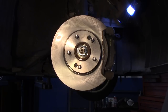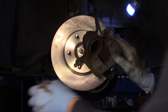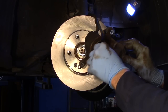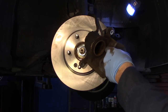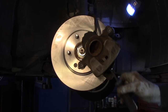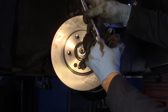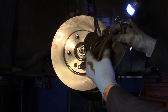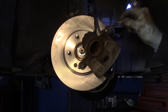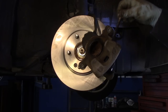Now that we have the torque specs, we're going to take our caliper and bring it down over here. This piece here doesn't belong on there — we just got to take this off. Now you see this piston right here — this piston is pushed back in all the way. We did that with that small pry bar before. But if it didn't push all the way, you put your brake pad back in here and use a spreader like this to push the pads back into the bore. That's not the case here — we actually pushed it in before, so we're in good shape. Every place that this caliper is going to touch into the brake pad, you're going to put a slight bead of silicone, just like this — just a little bit.